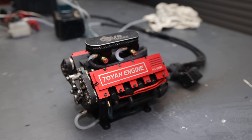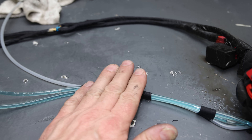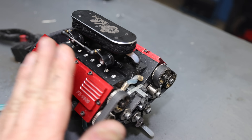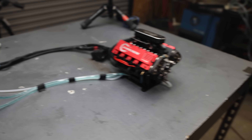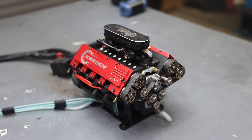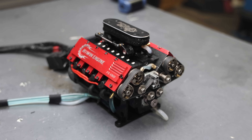This thing is hot — this thing is smoking. Our radiator feels pretty cool but the lines are really hot, and the engine has got to be 250 degrees. I do have a fan hooked up to the radiator with the overflow tank, and we can see some steam inside that overflow tank. That was the maximum RPM run — over 10,000 RPM. And it still doesn't sound like it's really breathing to me. I bet I could hit 12,000 or 15,000 on this.